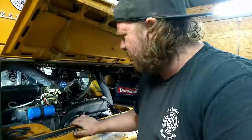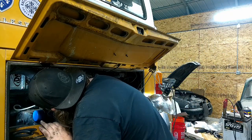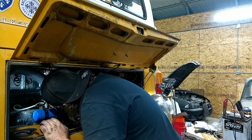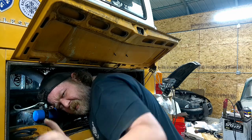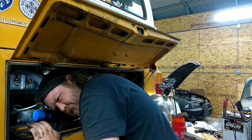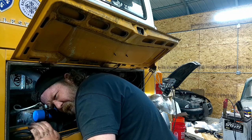All right, I'm actually back, rooting around behind the carburetor. The choke isn't connected. That would explain the richness. So let's connect this. Leave the key on for a minute, so it hopefully will catch up, and see if the richness goes away, because that would explain a violently rich system.